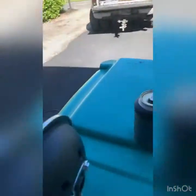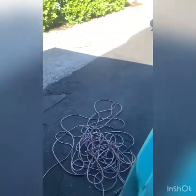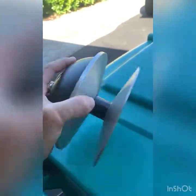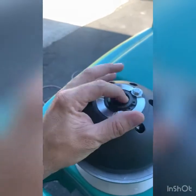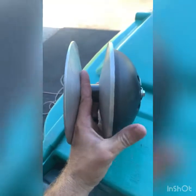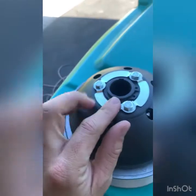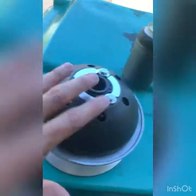We're in the process of moving, so the golf cart needs to be drivable — I'm not dealing with pushing it around. It's been sitting for probably five weeks. We're gonna put this new one on and see how it does. It fits any one-inch keyed keyway shaft. It's definitely a lot smaller than mine. I'm slightly concerned my bolt is not going to work — I may have to get a bigger bolt or just throw some washers on temporarily. Let's get the existing one taken off and then we'll do a side-by-side comparison.